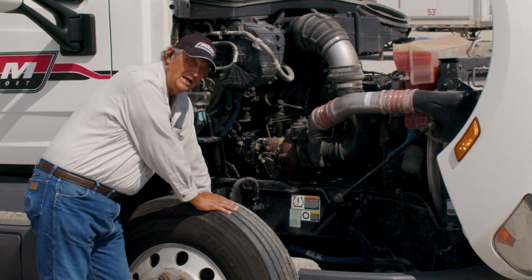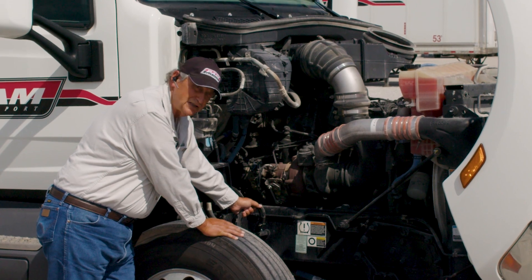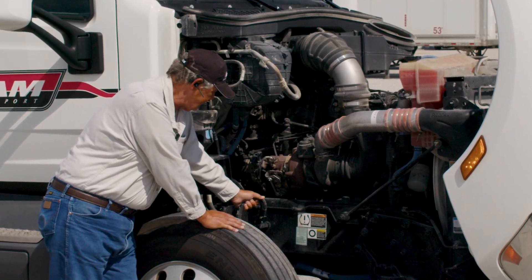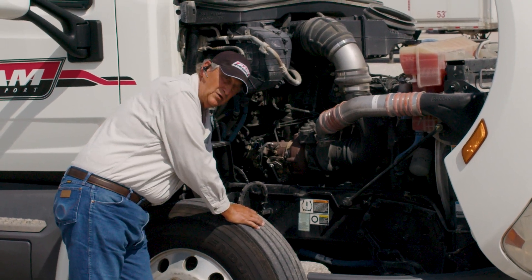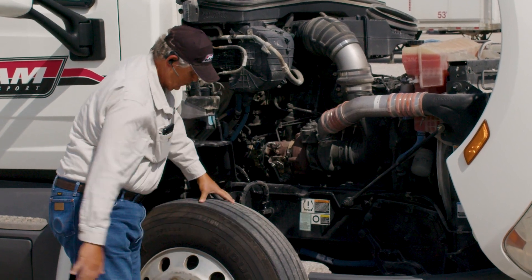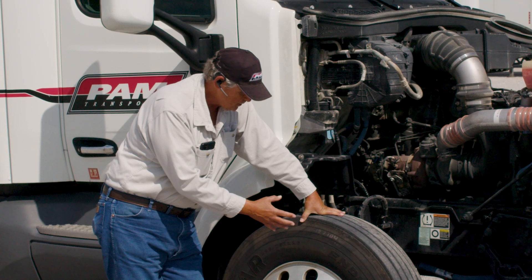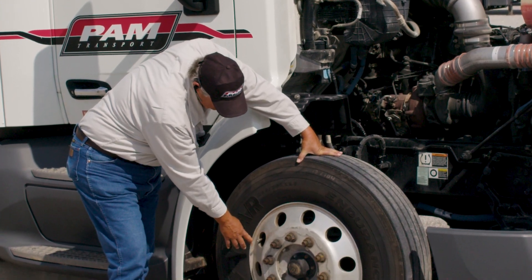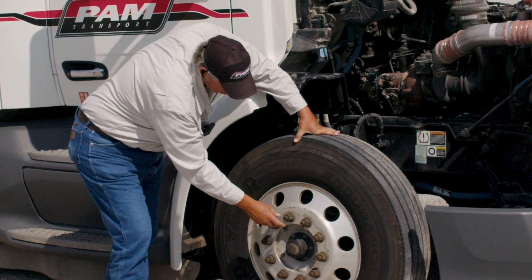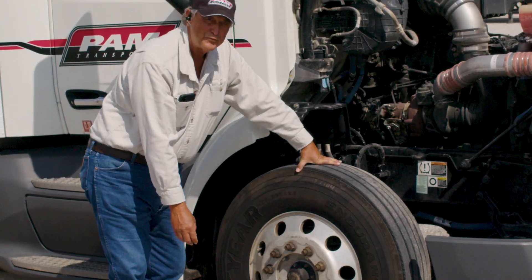We'll look in here on the side of the brake chamber. These Peterbilt 579s have disc brakes. The brake chamber needs to be securely fastened. Your air hose to your brake chamber needs to show no wear, no cuts, no abrasions. Your ABS line — make sure it's secured. Look on the inside of the wheel to make sure there's no obstructions, no leaking oil, or anything coming out of the seals. With disc brakes, it's hard to see your brake pads and calipers unless you take the wheel off. The rim shows no cracks, no illegal welds. All the lug nuts are securely tightened. There's no sign of any rust marks or leaking, no metal on the threads — they're properly secured.